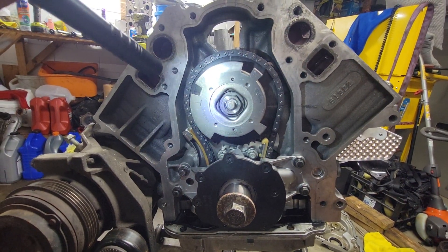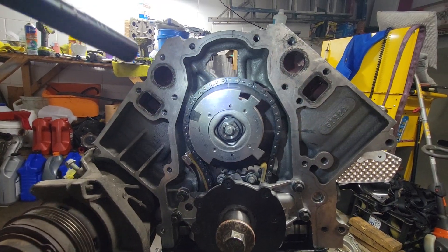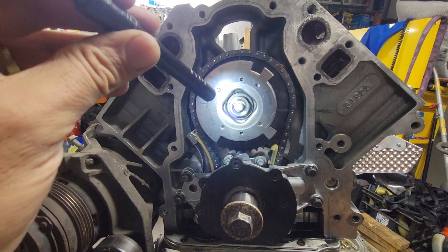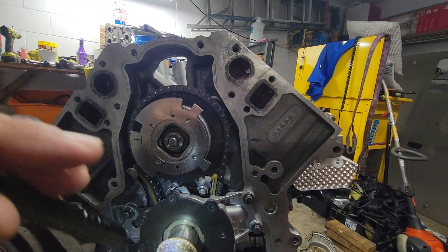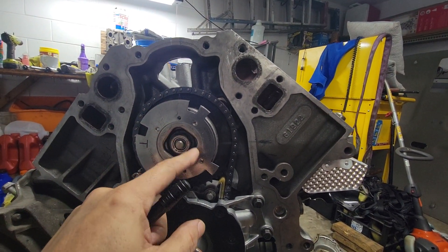I had the proper amount of oil, so I was always scratching my head why the oil light was on. A lot of headaches later, when I went to take this all out — I didn't want to — that bolt was loose. So I took it out and looked behind the cam phaser.